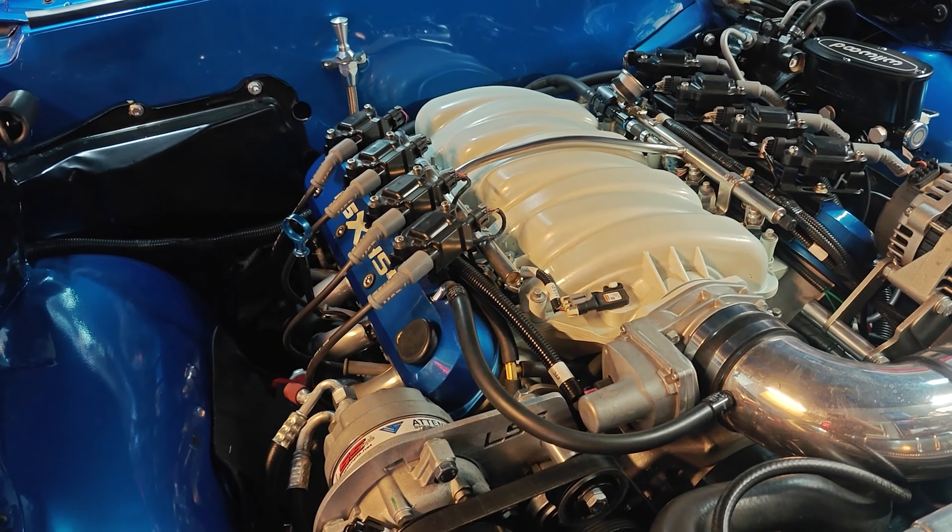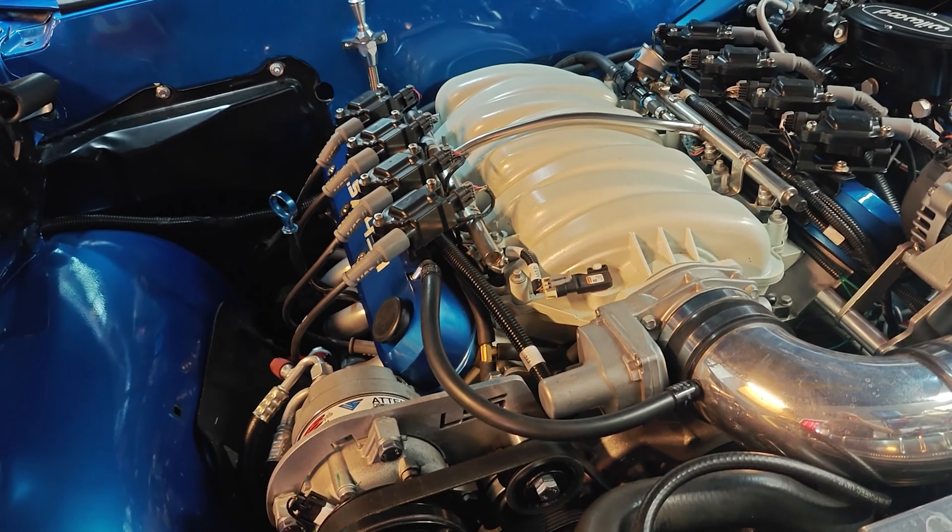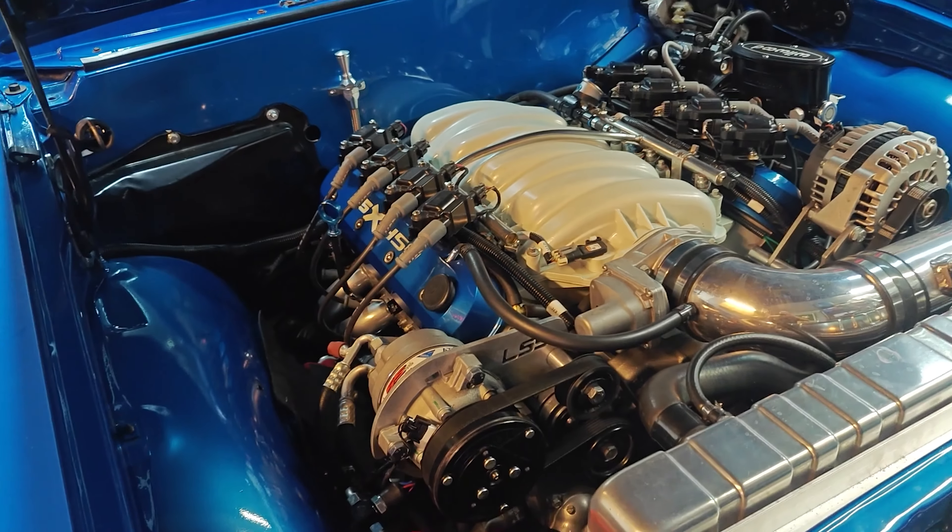The other valve cover back here was capped off. And the intake manifold, or below the intake manifold in the engine valley, that was capped off. And that was it. That's really bad — you do not want to have everything capped off on the engine, because the engine builds up pressure.